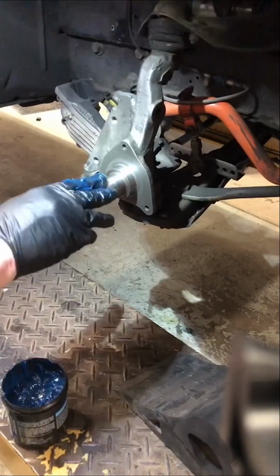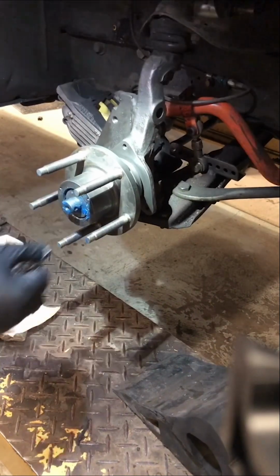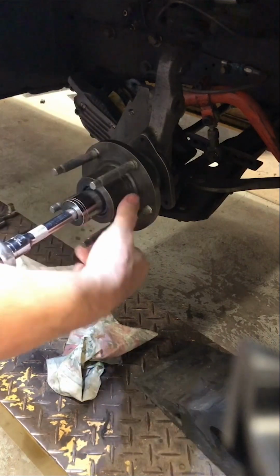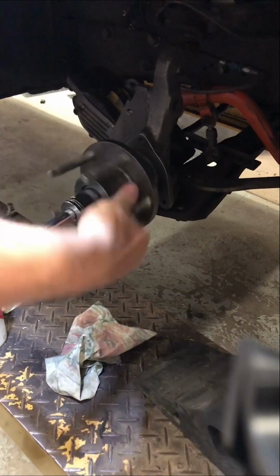With the bearings installed, now you can reinstall the hub. Clean the old grease off the spindle and lightly regrease it with bearing grease before putting it on. Take care not to damage or pinch the rear seal. Bearings need to be adjusted or seated correctly, and all vehicle workshop manuals will have various specifications or techniques to do this. I use the wheel bearing replacement tech tips for medium duty vehicles produced by Timken Bearings.